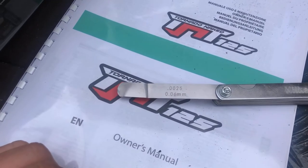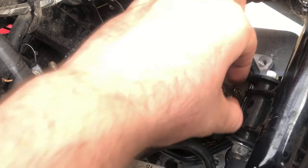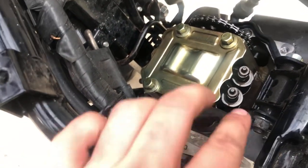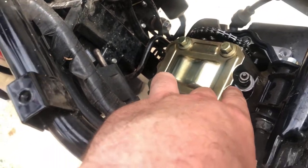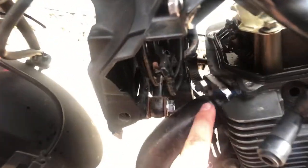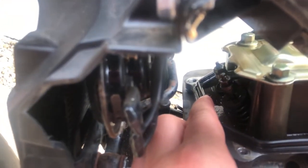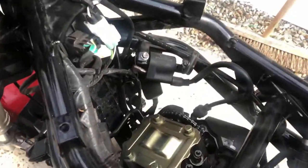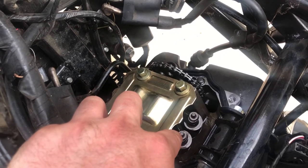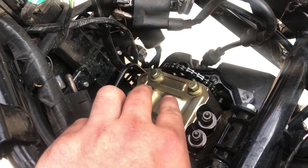After doing a little bit of research off camera, I've decided to go for the 0.06mm spec. The first couple of valves I'm going to do off camera just to suss it out since it's my first time on this bike. If you look at these valves here, they've got a bit of clearance - that's a good thing. I've actually done a little valve clearance on these two, but these two have a bit too much clearance, so they'll need a bit of reducing. These two here are your inlet valves, and then here are your exhaust valves. With the exhaust valves, they ain't moving at all - they're very, very tight, which is common. So I'm going to start off on the inlet valves first, as they're quite easy - I've just got to quickly reduce them. Then I'll get a bit of footage doing one valve just to show you.